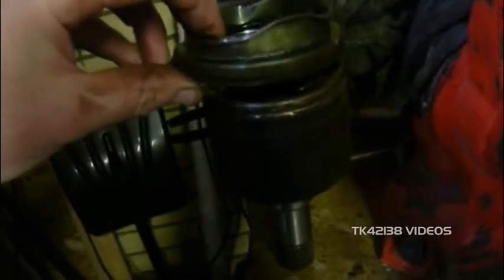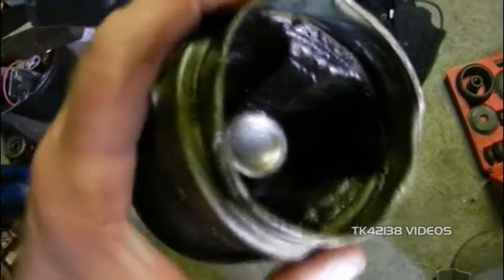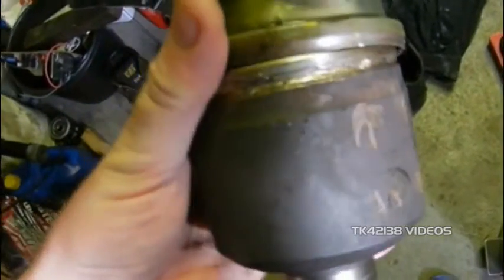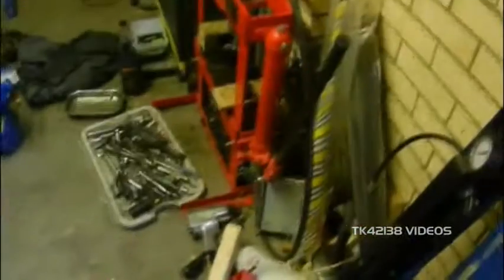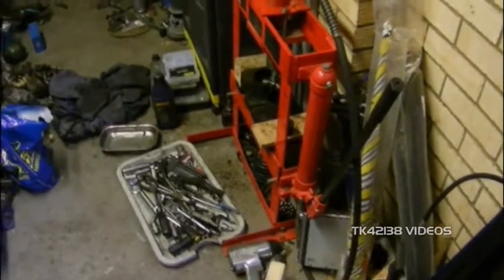What it does — I've just started with this — I had to basically cut it off. It sits there, but it actually reduces the inner dimension so you cannot remove the tripod, the spider, and slide it off with this on. Which is why Haynes says strike it sharply, but it's taken a tonne — maybe a bit more — to shift that tripod joint on a press.